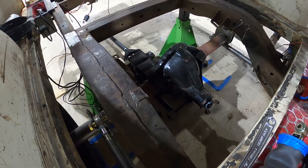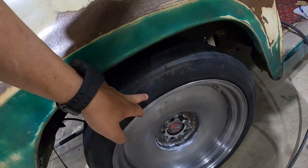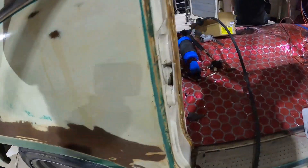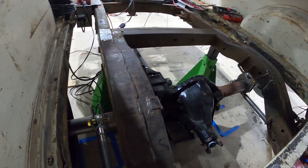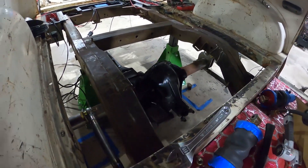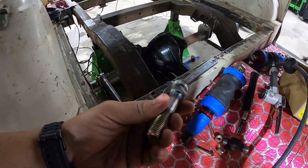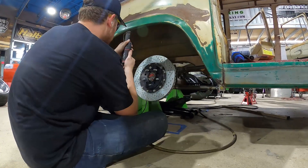From the time lapse, we removed the bump stops, jacked it up as high as we could, and noticed it's just not low enough. The tires are hidden inside the inner lip, so we're going to trim that back to get the rear axle as high as possible so we can get the truck as low as possible. We're not doing a C-notch or anything crazy, but we want to maximize how low it can go. We'll trim that inner lip first, then reinstall the shocks and move the upper shock pins on top of the frame rails instead of on the side.